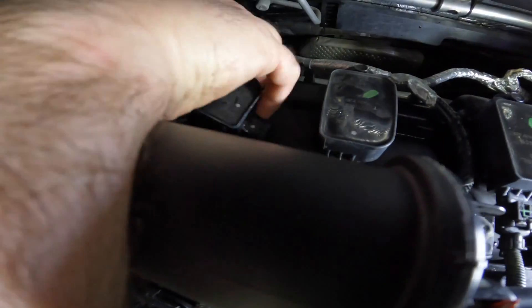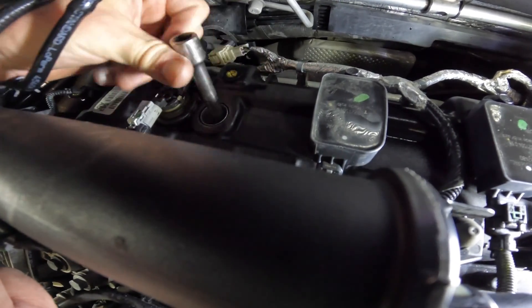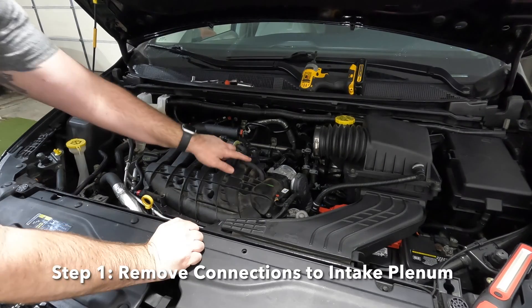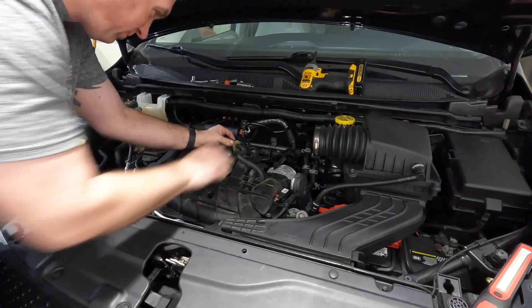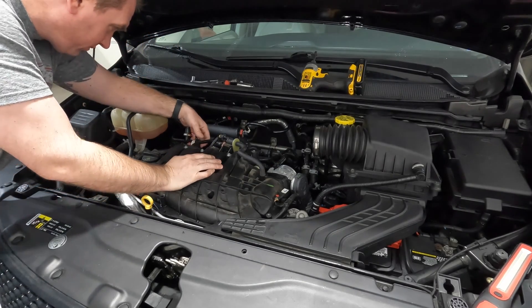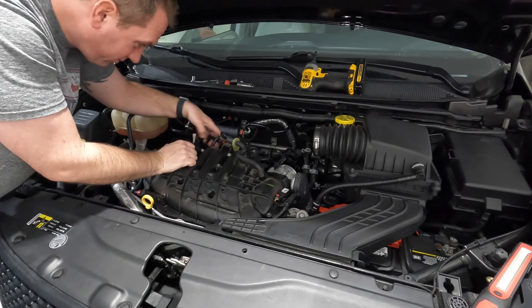Here's a time-lapse completing cylinders 1 and 3. To complete the change on the even-numbered cylinder bank — cylinders 2, 4, and 6 — the process is significantly more complicated. We need to remove the intake plenum to access these. You'd think it might be easier since they're on the front side of the engine, but unfortunately it's actually harder.